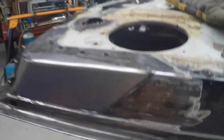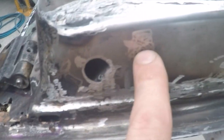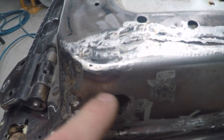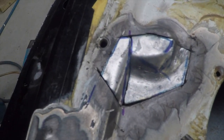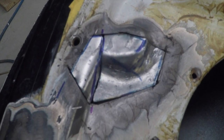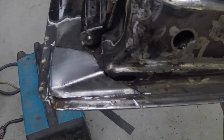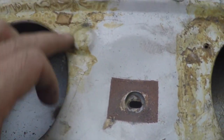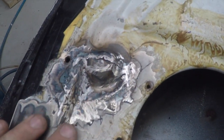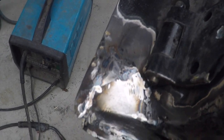That was about half an hour of cutting and shaping but you can have a look here and see that it actually is quite a good fit, the piece that I've just made up. And here it is all installed - it's welded and I've ground it back as you can see there. I did a couple of plug welds here to join it onto that sheet metal panel that was under there, and also did the big drain hole that's here and welded it on. These ones were a pain in the backside but I've sort of made two pieces there and made a bit of a ball shape. It's not exactly the same as the standard one but it's the best I could get it with the hammer and dolly. You can see the corner patch right here, and the rest of the panels are pretty good, all these corners are welded in.